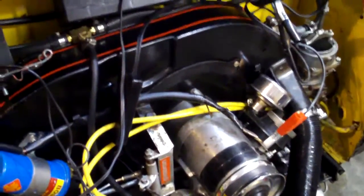The problem with the engine is the carburetor on this side. Let me switch modes — you can see, I don't know if there's enough light, but when you push the throttle, you see a little bit of fuel coming out. Going over to this other side, push the throttle — nothing happens. So this side isn't getting any fuel from the carburetor into the engine, so if I try to start it, it all just runs on that side and not this side.